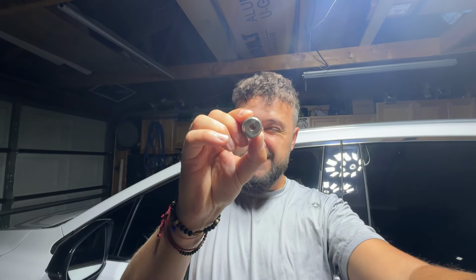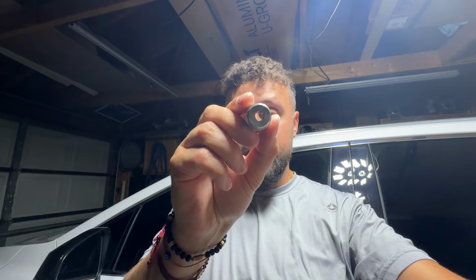So then what I did was install just this piece and put the sensor in. This one has the smaller hole. Hopefully you could see that hole. I put this in, same code, slow to respond, lean to rich, blah, blah, blah. I had the same one with a bigger opening hole. I put that on, perfectly fine.